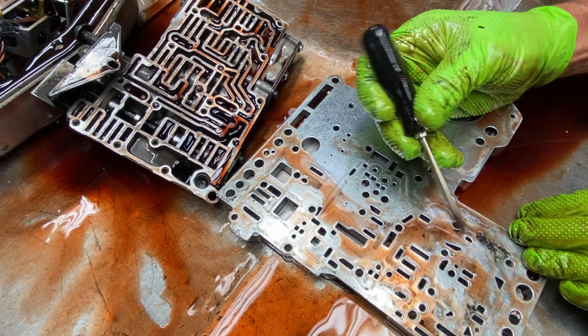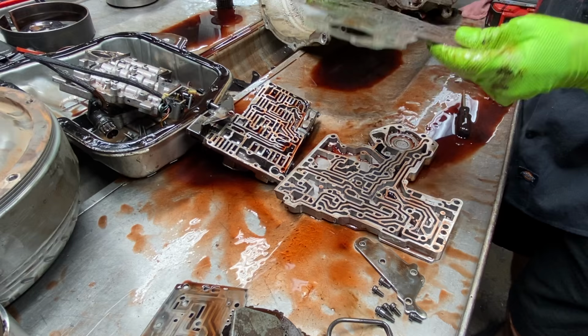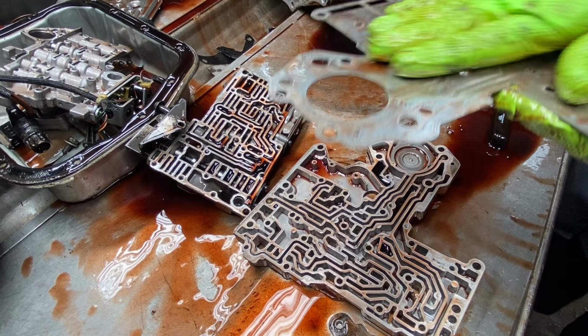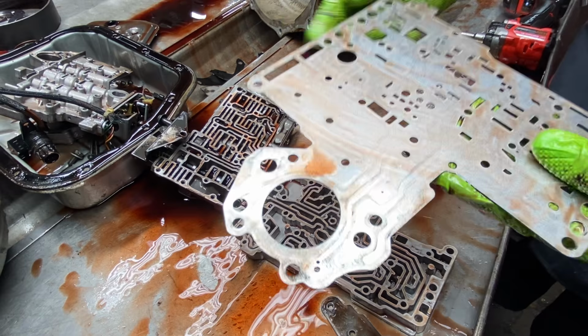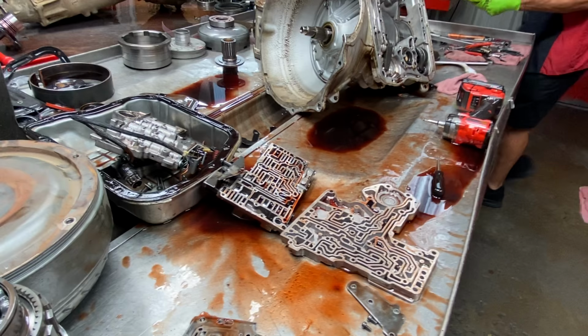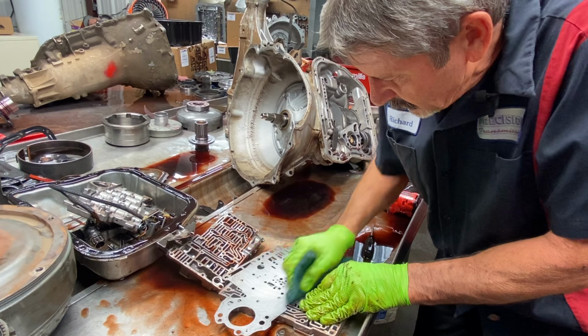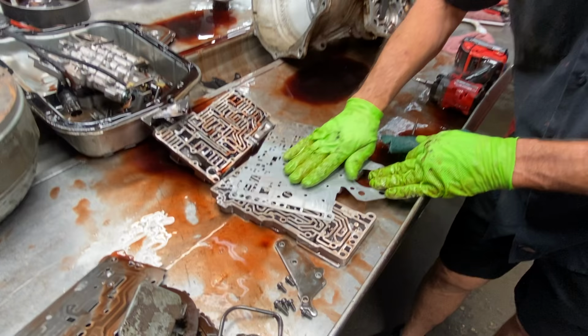Now we do have this hole here that is going to be modified, and this one here is going to be modified. It's going to tell you in your instructions. But every one of these plates is cut back, cut out this way, and then you have this roughness over here, guys. If you could grab this and feel this right here, there's such a lip around every place this thing's been stamped out. It's unreal. So when you tighten this down, to me, there's physically no way this thing can set perfectly flat. You have to get in here. If you take a piece of Scotch-Brite and you just come in here and Scotch-Brite this plate, just like that, you would not believe how smooth this plate gets when you take all that off. I mean, it just smoothens it right up from here to here.